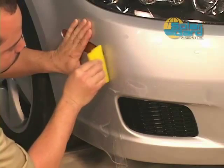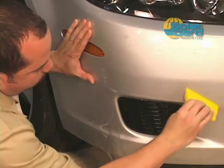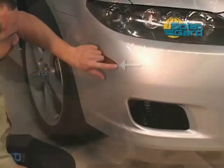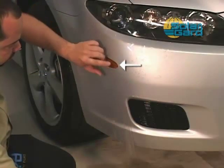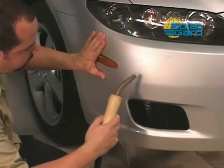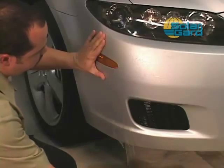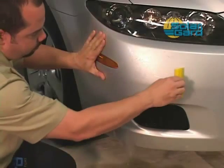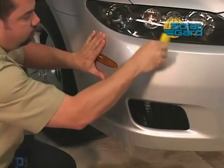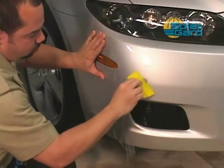Sometimes a little water and alcohol solution will help make sure your first or second squeegee pass holds the pattern in place so you can go to the next focus point. An area like the marker light where the pattern wraps around should be squeegeed completely, up to an inch around. Again, as you need the material to tack more quickly, you can spray water and alcohol mixture to accelerate tack. Continue to squeegee the mounting solution to the edge of the film, working towards the marker light.